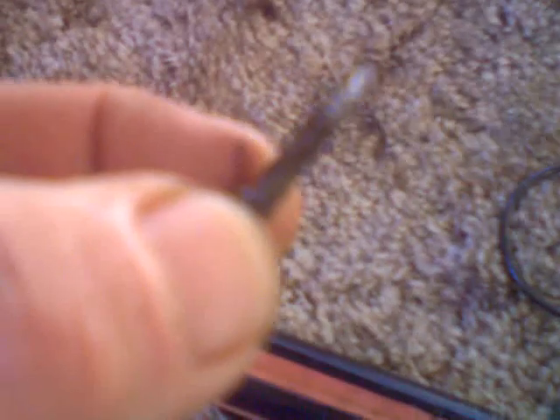I guess I was thinking somehow this big spring right here was supposed to go in there — it doesn't go in there, so I was trying to do that. I didn't think this tiny little thing would make a difference. It does — otherwise you can't put this little C-clip, this little dealie. You gotta take these two pieces right here — they go in front of those two locking nuts in the hub, and I didn't think that little bitty amount of space was anything, so I left it on there. Well, that little bitty amount of space matters because now you have to put this little C-clip on the front of the hub.